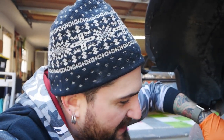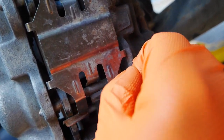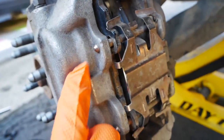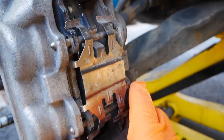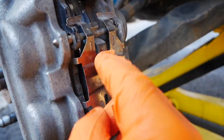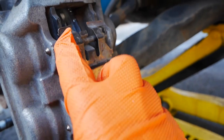It's very simple. You just need some needle nose pliers to take out a couple of pins and then you swap them out. You're going to have to compress the caliper a little bit. So as you see here, there's a pin there that's got to come out — got it with my hand. And then you have one up there that's got to come out too. You're going to need a drift pin or screwdriver to tap these out. They're not in there tight, but you just need something to help you remove them. Make sure this doesn't launch across your driveway. Then the pads slide out.